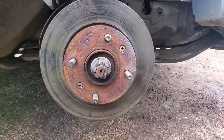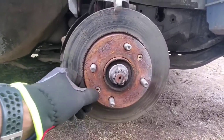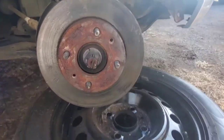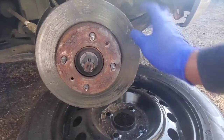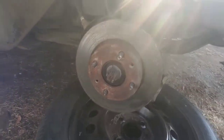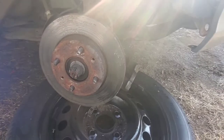Sometimes you have these screws in here and sometimes they're a pain — these are probably going to strip, but you've got to remove these in order to take out the rotor. All right, so we got the rotor screws out. The rotor is a little stuck on there, so what you're going to use is your mallet and hit on the outside. I turned the wheel so you can get behind here and tap it off. Depending on how stuck it is, that's how hard you have to swing.